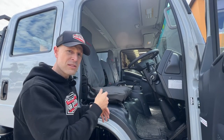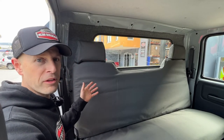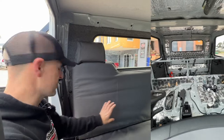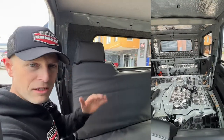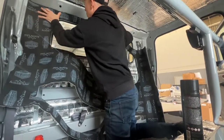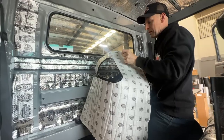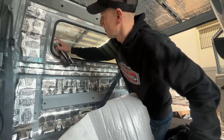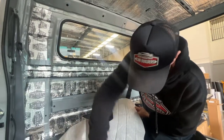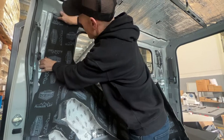The next bit is the rear firewall, which comes with no insulation on it. The first thing you want to do is put your vibration dampening mats — your stage one sound deadener — and stick that to all the single skin sheet metal areas. There's a top hat section beam that runs across there; no need to do that. The acoustic liner, which is your twin layer foam, we've got pre-cut to this shape. It's a self-adhesive product, but given the amount of ribbed structure in there, I personally like to use a bit of spray contact adhesive. The reason is that we're going to put carpet over the top, and in those deep valleys that adhesive may not be enough to hold. So spray adhesive on the contact side and the stage one sound deadener face, then stick that on.